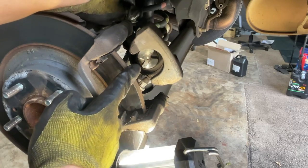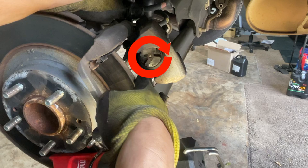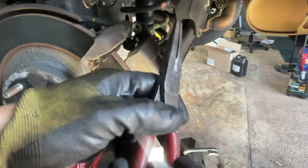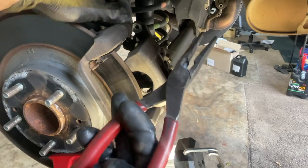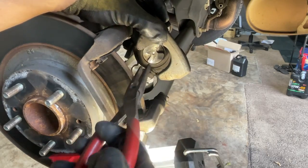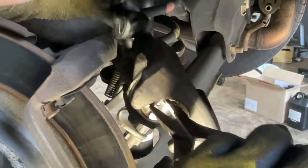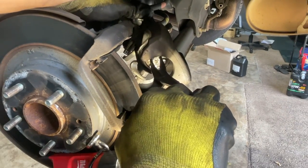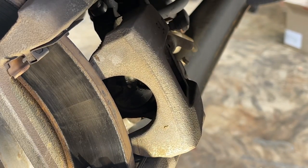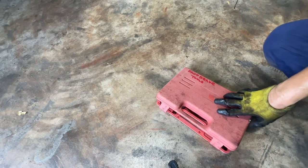Okay, this is the fun part. You can see the piston - we're going to turn that one clockwise, going to the right. Sometimes we can use long nose pliers if you don't have special tools. We can try to spin this one - there's a groove inside. We can put our long nose pliers there and turn it clockwise. Yeah, it's quite hard - sometimes you cannot do it without special tools.